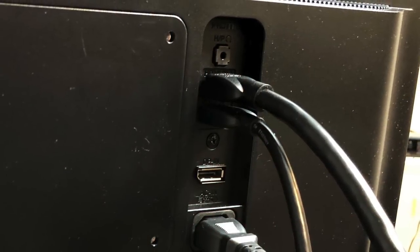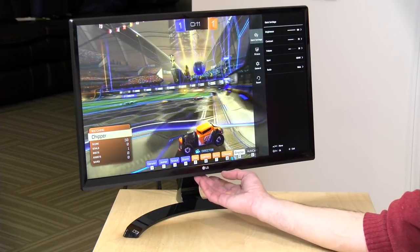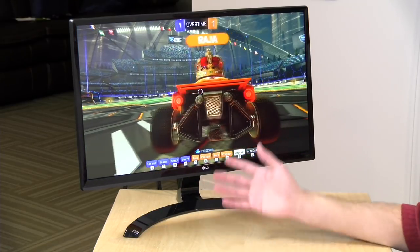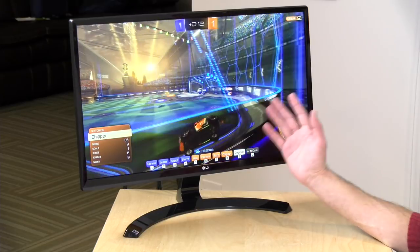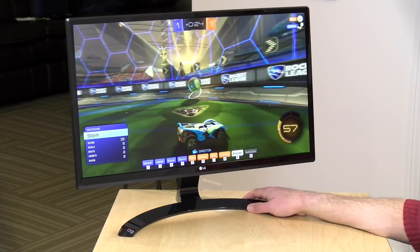It's got three inputs: two HDMI and one DisplayPort. On the HDMI ports, they're defaulted to 30Hz until you enable HDMI deep color mode. You get there using the joystick on the bottom of the display — go to Menu, Picture, Picture Adjust, then enable HDMI Ultra HD Deep Color, which gets you 60Hz as well. It puts the HDMI port into a different mode to support the greater data needed for that frame rate and for 10-bit color, but it does not support HDR.